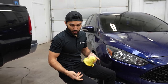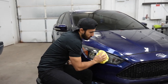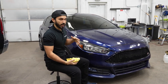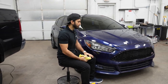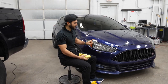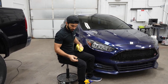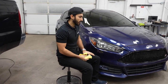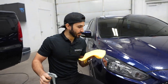Now we've sprayed the alcohol — it's 99% industrial grade, slightly diluted — and I'm going to wipe it down. I did modify my templates a little bit: I extended about half an inch all the way across. If I don't extend it, there will be a gap of about an eighth to a quarter of an inch all the way around. By extending half an inch I get full coverage. Now I'm going to wipe it down one more time with a cleaner towel and then transfer the film.